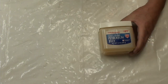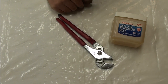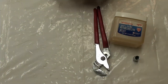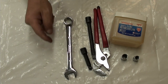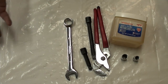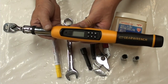The tools you're going to need for the job: I'm going to use a little petroleum jelly on the inside of the tubing. I don't have special tools for those clamps but this seems to work pretty good. You'll need a 10 millimeter socket and a 13 millimeter socket, a short extension, a long extension, a 19 millimeter open end for adjusting your belt. I like to mark my bolts after I torque them. You'll need a torque wrench capable of 25 newton meters.